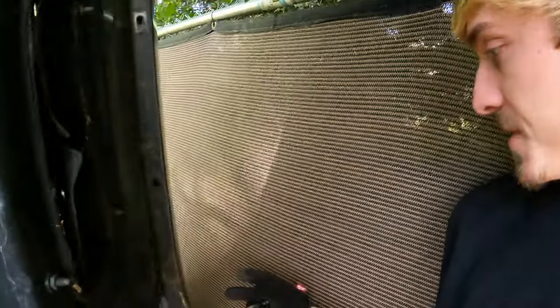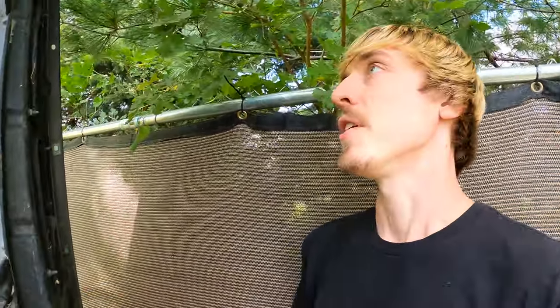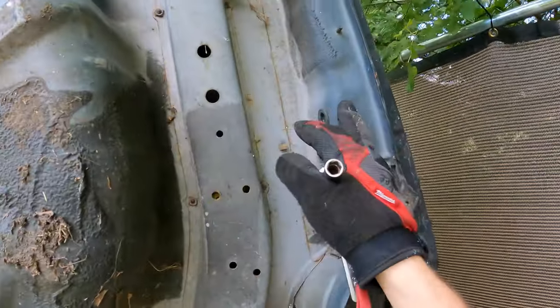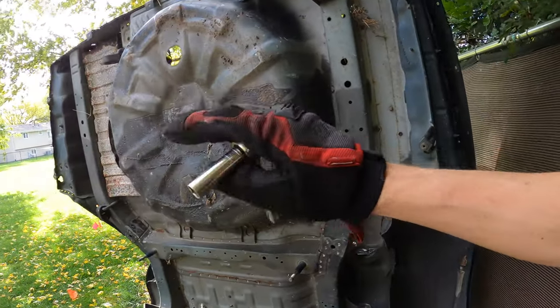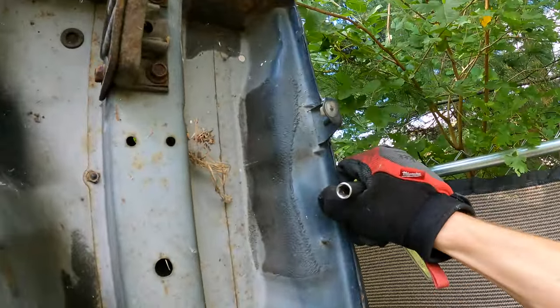Since this side of the car was T-boned I'm not going to take off the entire quarter panel — I might just make a cut from here down. I still don't have my new OEM quarter panel shipped over from Japan, although it is in shipping right now, but that takes forever. So I can use this rear end as a jig to make sure that the floorboard is in line, because once we start aligning the trunk and rear frame rails to the car there's going to be a lot of play. That'll be one more piece to verify it's in the correct spot.